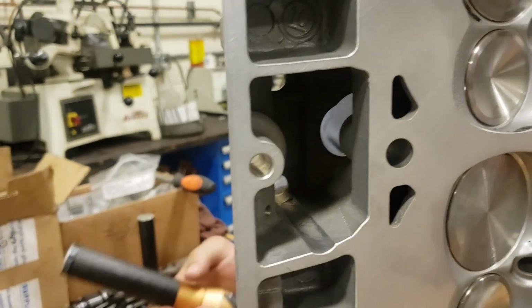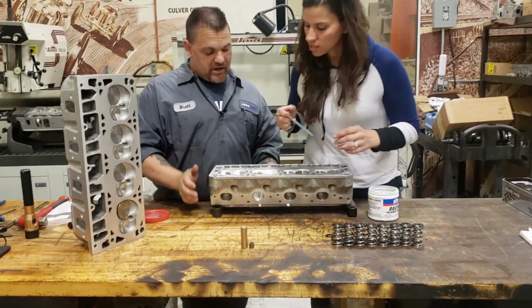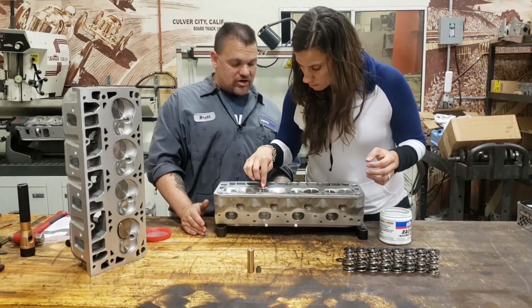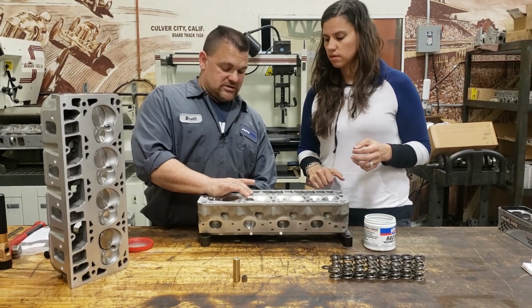Are those the brass valves? Those are the guides, yes. So the guides go in the head to keep the valve moving straight. Right. Okay, do they wear? Yes, they do. So if the rocker arm geometry is not correct and the head's not set up correctly, it'll cause that. Yep. So, got it.